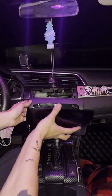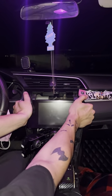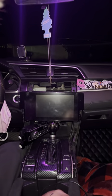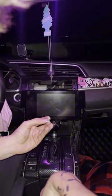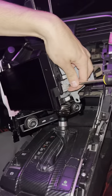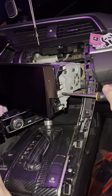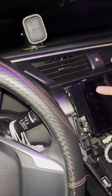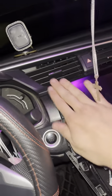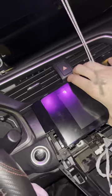Put the new screen right back in exactly where it went. Pop it in, holding from both edges. Now grab your screws that came out of the sides originally — two on each side. Grab your flathead and get those in. Then grab the other two and move to the other side. Once those are in, pick up the entire screen, slide it back in nice and gently, make sure the wires are hanging, and give it a solid push on each edge to lock it in.